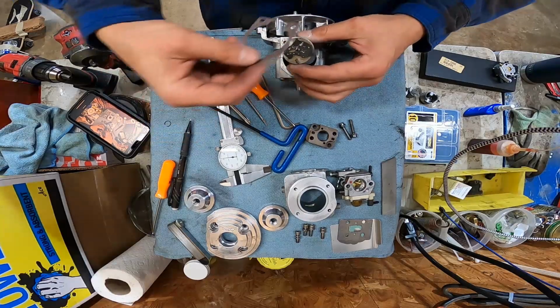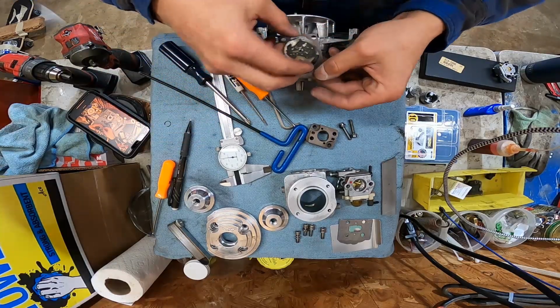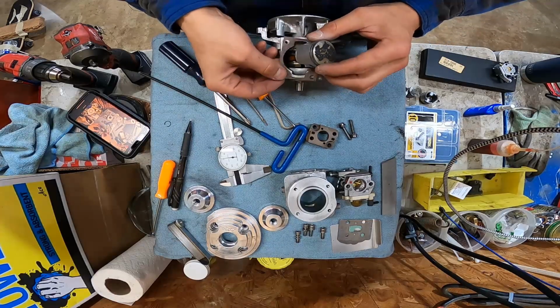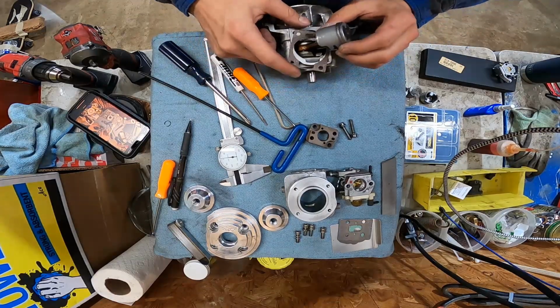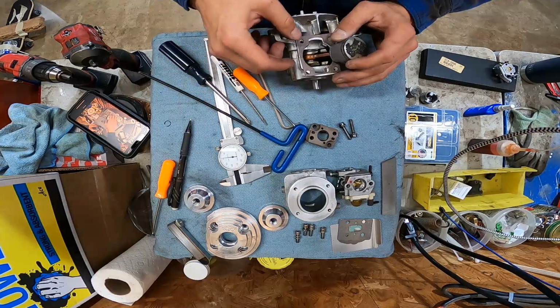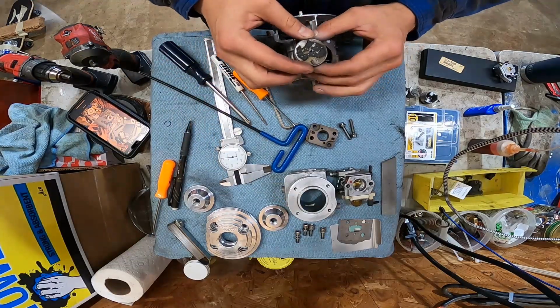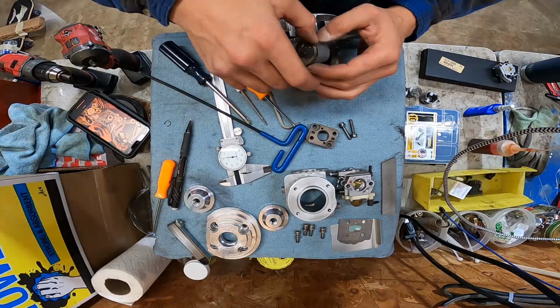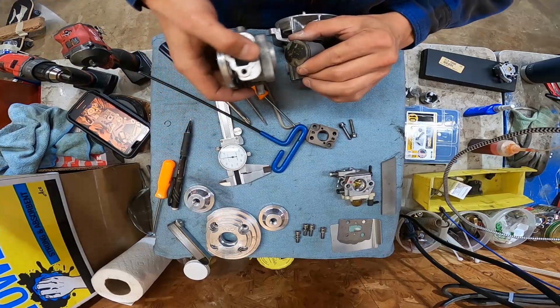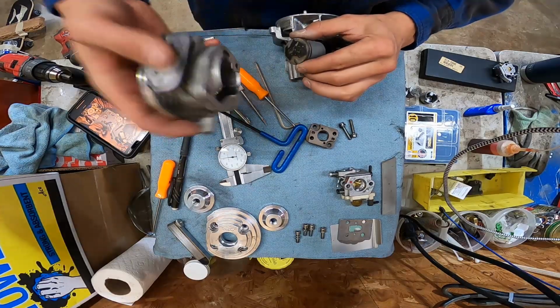Okay. Sorry, I'm just extremely exhausted. Boop. So I cut this gasket. I mean, this looks really thin, doesn't it? And I actually cut it based on the print that was left from this thing getting squeezed by the cylinder and the cases. And that is all that seals the side of the cylinder. Pretty scary. Let's not put that on backwards.